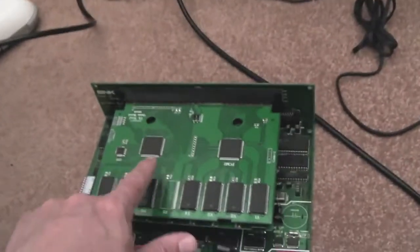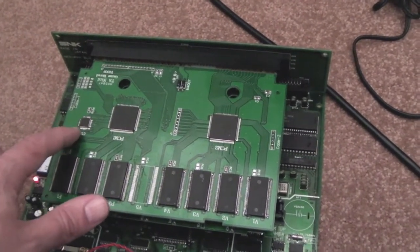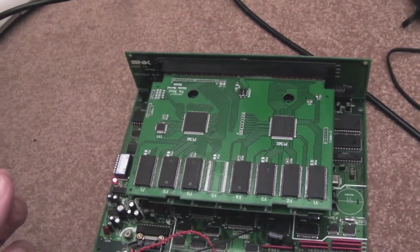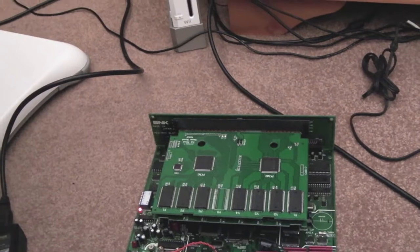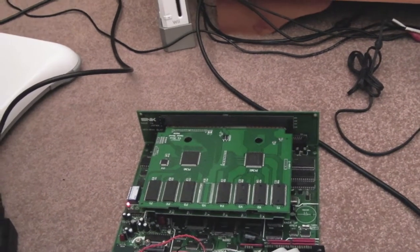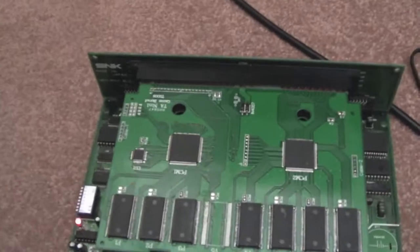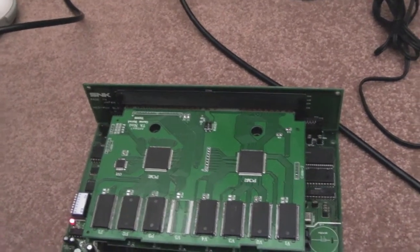I'm going to do some measurements on these. First of all, on the CPU, and determine where the +5 is and the ground. And I'm going to put a decoupling cap across that and retry it, because this has got to be some sort of capacitive reactance type thing going on here. Might be using the term reactance wrong there. My knowledge of reactance and capacitance and capacitive reactance is very slim to none, but this just feels like an RF. I'm getting some noise somewhere. Maybe there's not enough capacitance going on. Me just interacting with that is either affecting the RF signature or it's affecting something somewhere.